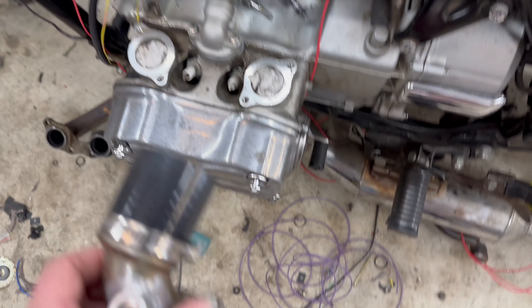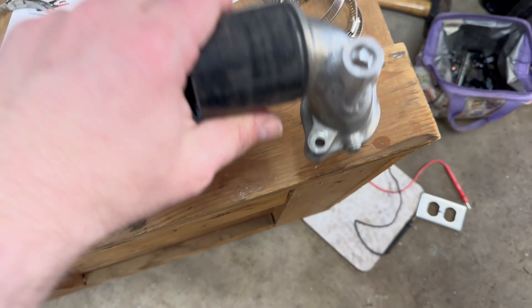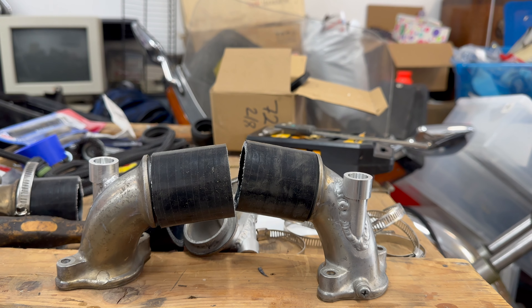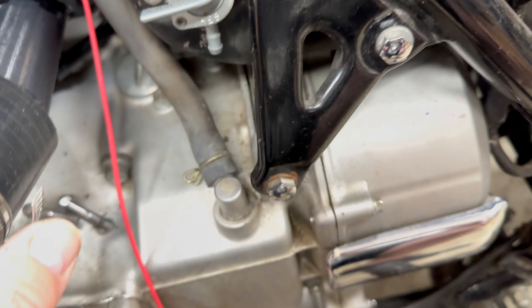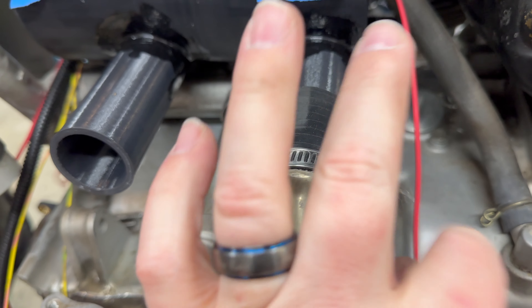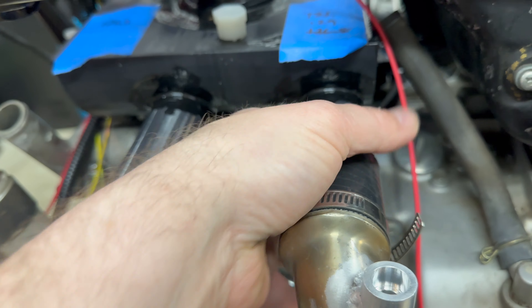Now taking this over to the manifold. These — I should show you — I'll get two of these flat. You can see they've got a slight upward angle. I probably should have made my manifold so the tubes pointed just down at a slight angle. I could probably get an angle finder and figure out what that angle is. I think it'll be fine — I've got plenty of excess tube and it's rubber so it'll be okay. I can fit these nice and deep onto here, then they bolt down. I'll put another clamp there and cut off the excess. These were for 45–50 millimeter but these are 40, so it fits nice and snug.